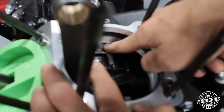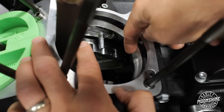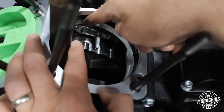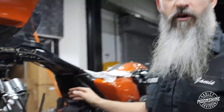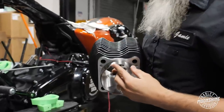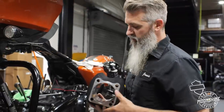It allows us to get that really thick sleeve in our cylinders. We also have to bore the case around the piston jet so our cylinders slide all the way in. The spigots of the cylinders go around it — this part is down a little farther than where the top of the spigot is, so our cylinder sits in here, goes right around that, then continues around this way. It allows it to have more support when that piston's at the very bottom. This spigot is cut to go around the piston squirter that's squirting oil right in the middle of your piston, keeping the bottom side of it cool.